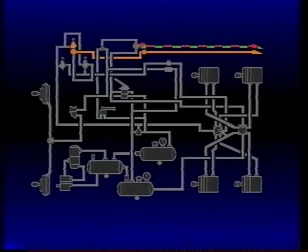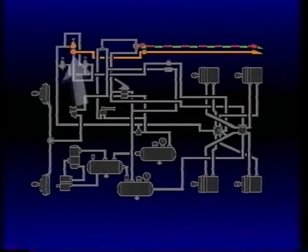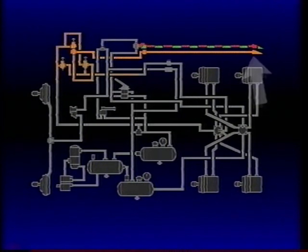The other half of the team, the PP7 trailer supply valve, is mounted on the vehicle dash and is easily distinguished by its red octagonal control button. The PP7 controls the flow of supply air to the TP3 and subsequently to the trailer. In addition, it synchronizes the tractor protection system with the tractor parking system. One-button parking control is thus achieved.